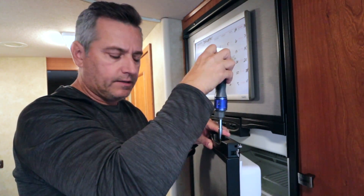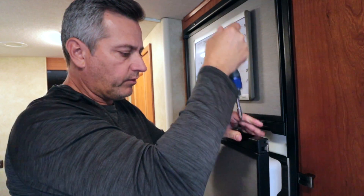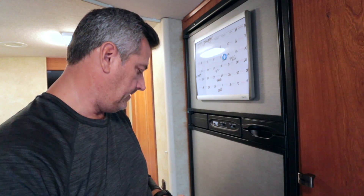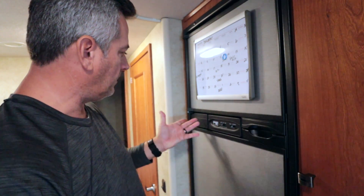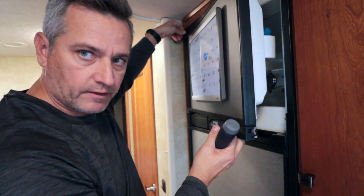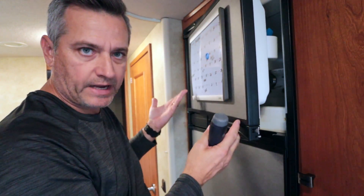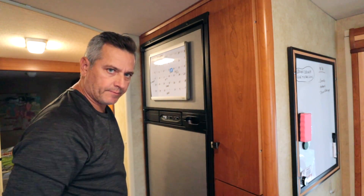Really simple process. If you haven't already, I'd certainly recommend replacing your hinges — as long as the bottom hinge isn't already broken — because it'll help the longevity of that hinge and give it some extra stability. Definitely a must-do. The freezer door is much simpler — basically the same process. Just open it up, take it off the frame, slide the reinforcement bracket into place, and put it all back together the same way.